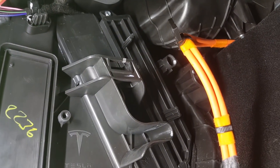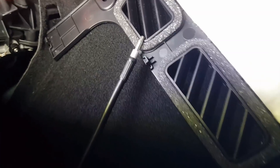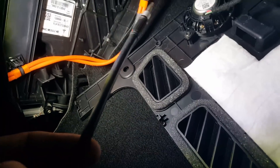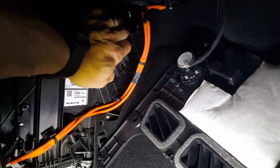At the top of the cabin air filter door there's a silver T20 screw we need to remove. I'm going to use one of these flex joint screwdrivers with the T20 bit at the top. Here's that screw removed, and then we just pull the door off.